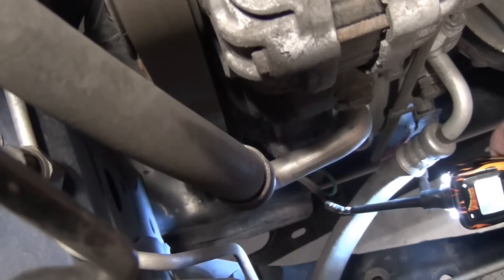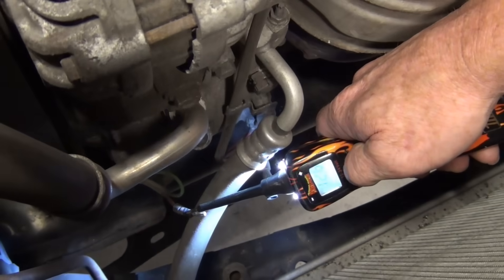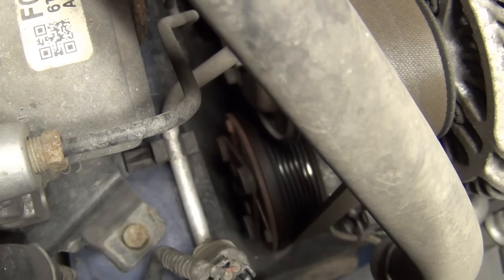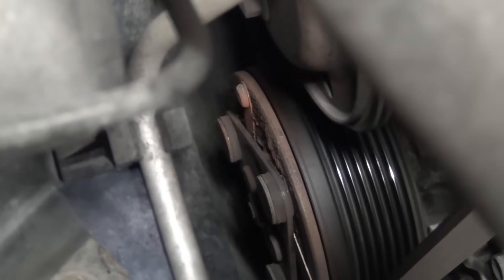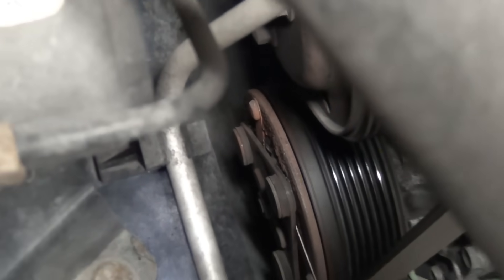This is the power wire for the compressor clutch. You don't hear any clicking, do you? The only clicking you hear is from my thumb. When we look at the outside, we don't see the compressor clutch engaging at all. Another indicator that it was the clutch — when I looked closely, I could see a bunch of rust and oxidation. Oxidation means things are burned, rusted. Rust is literally a slow burn. Up close we can see melted black compound pieces and shaved metal. It's just in rough shape — this thing's got some miles on it and unfortunately it's just worn out.